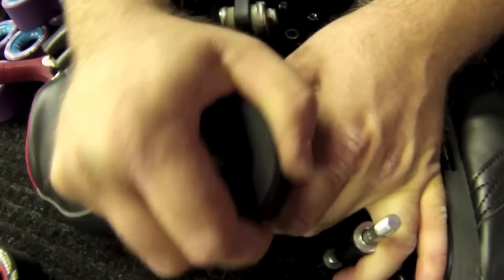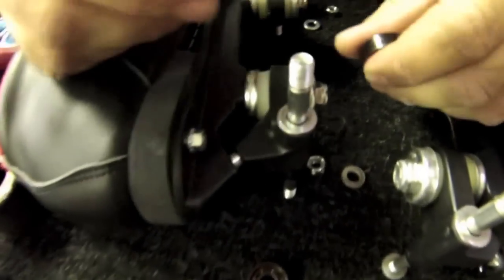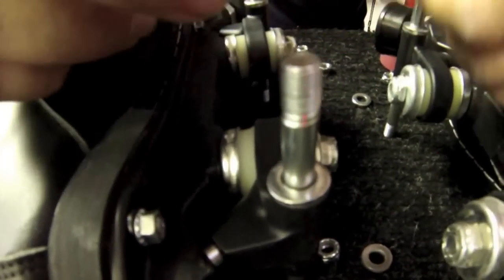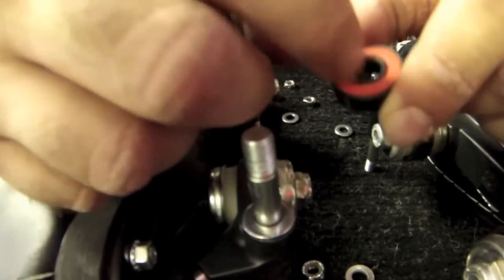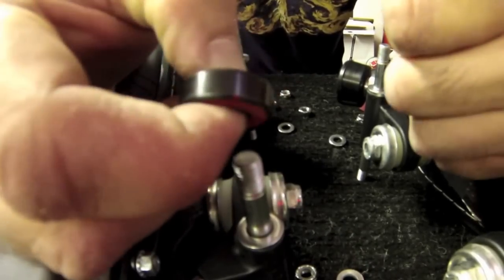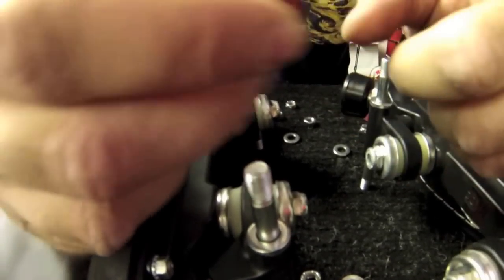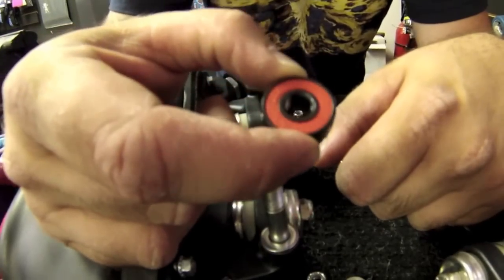There's a lot of misconceptions where people tell you to use screwdrivers and everything else like that. But the problem with a screwdriver, if it's not an 8mm axle, the same size as the center of the bearing, which is 8mm, is that you'll pry on the raceway to the point where it'll start putting play in your bearings or slowing them down and creating more friction. So you want to make sure you use something that's just as wide as the center of the bearing. That's kind of a big deal.